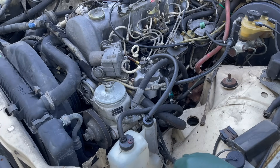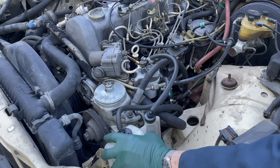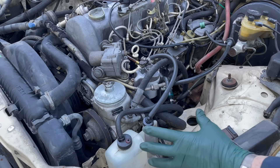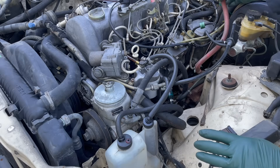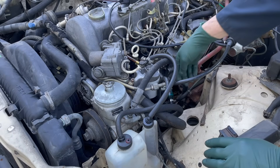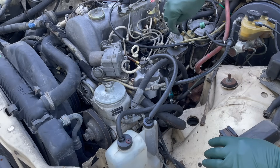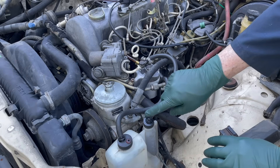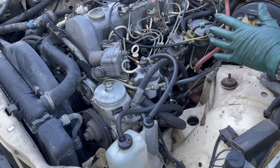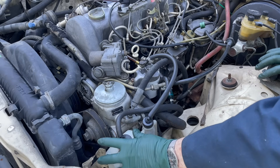Let me quickly describe what I've done here. This is the emergency diesel fuel tank that I designed and sell on my website — it's also great for running diesel purge through the engine. I've separated this from the fuel system. This line coming out of the tank is hooked up directly to the lift pump. The return line instead of going back to the fuel tank comes right back into this tank. This means I've isolated from old fuel and from a plugged fuel screen. Now I'm going to start the engine and run straight diesel purge through the injection system.